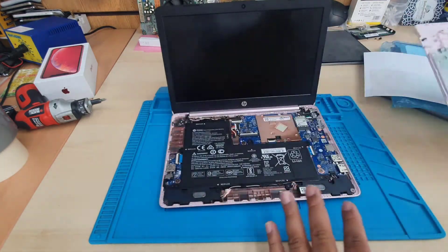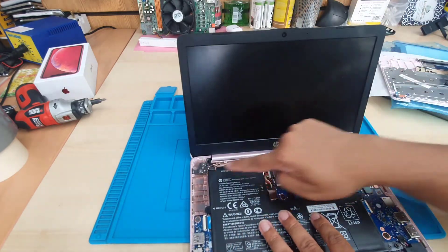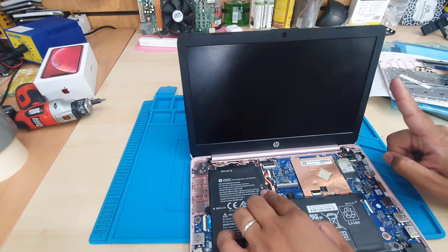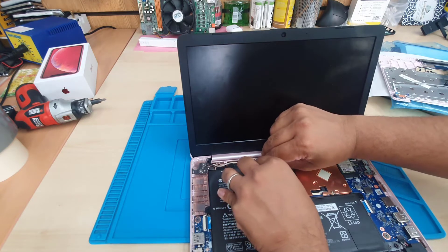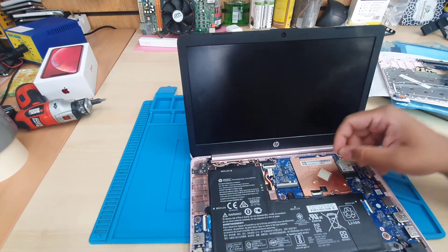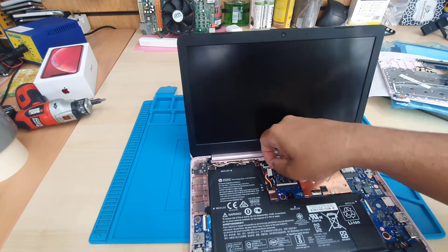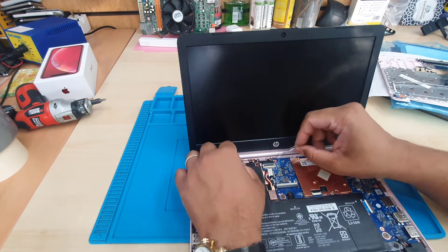This panel has three different flexes. Now it's super simple. The first thing to do is disconnect the battery connector. Once the battery connector is disconnected, we're going to open up the display connector flex — that's the one right here.